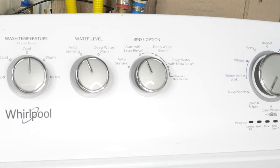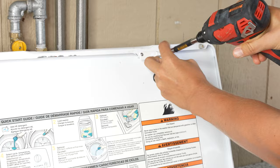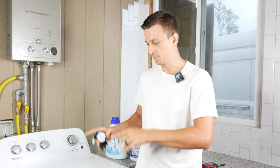With this kind of Whirlpool or Maytag washer, a very common reason why that happens is a faulty shift actuator that looks like this. I double-checked this by taking off the little striker from the lid and putting it into the door switch so I can see the washer while it's running with the lid open. And sure enough, it was doing everything except that final spin cycle. I've replaced a lot of these shift actuators on washers like this — oftentimes if your washer is not spinning, it's because this part has gone defective.